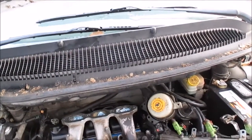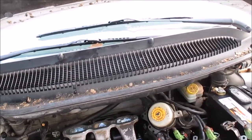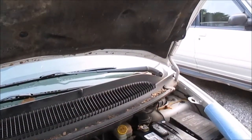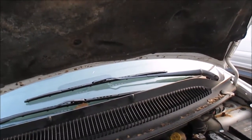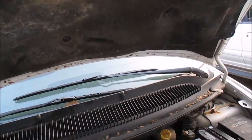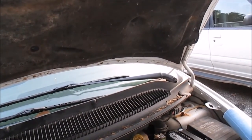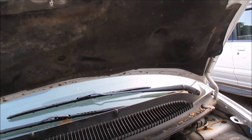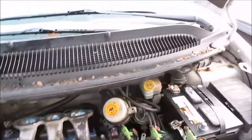To get foot pounds from 105 inch pounds, 12 inch pounds equals 1 foot pound, so it's not very much. If you don't have an inch-pounds torque wrench and you have a foot-pounds one, you can use that, but you got to do the math. For every 12 inch pounds equals 1 foot pound. So anyway, I'm gonna go get my torque wrench.